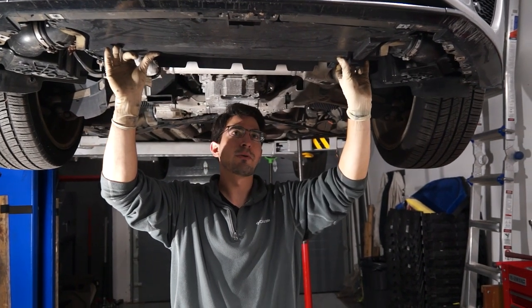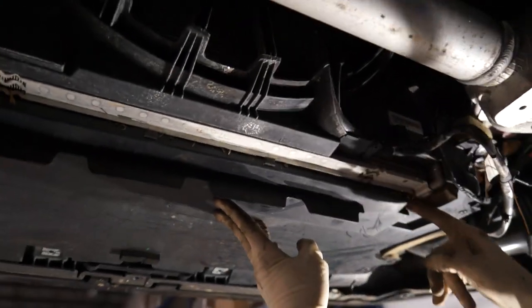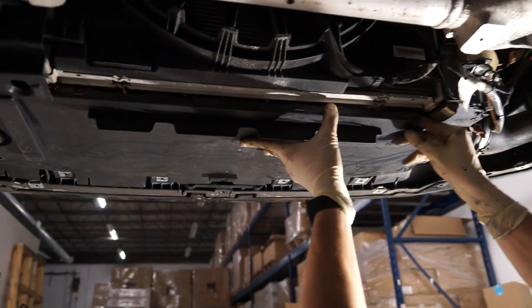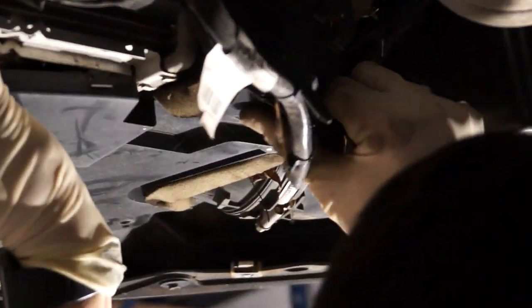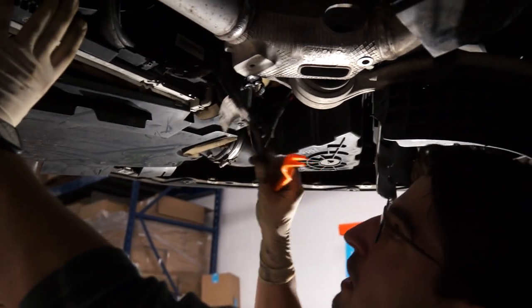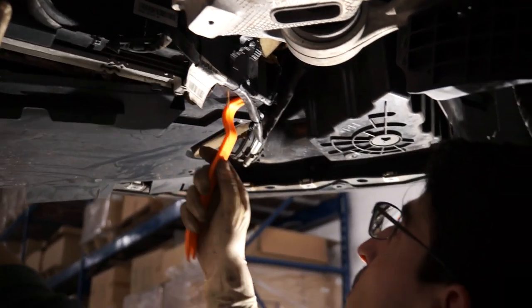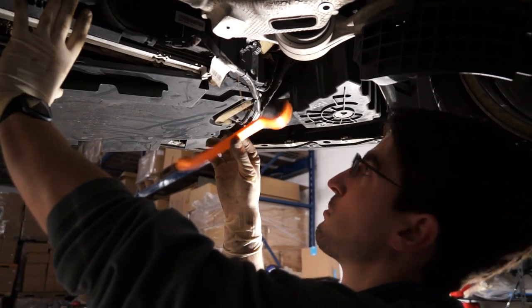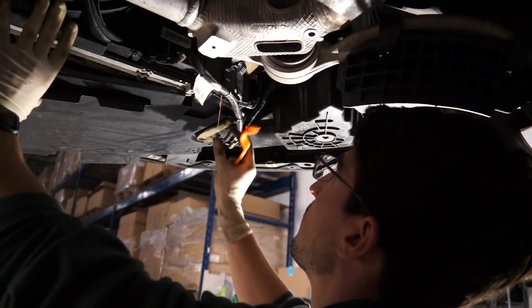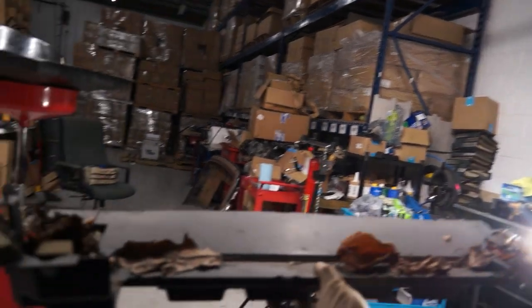Once you get all the hardware out, come in here — I'll come closer so you can see. Just put your finger in here. Fan, radiator — there's this opening and just pry. There are snap clips that grip the radiator and then you pull it off. On the passenger side we have the connector for the electric fan and then a sensor that has a push clip going into the under tray. Get one of these trim removal tools and pop that out. After that it should just come right out, exposing all the leaves your vehicle might have picked up in the past 50,000 miles.